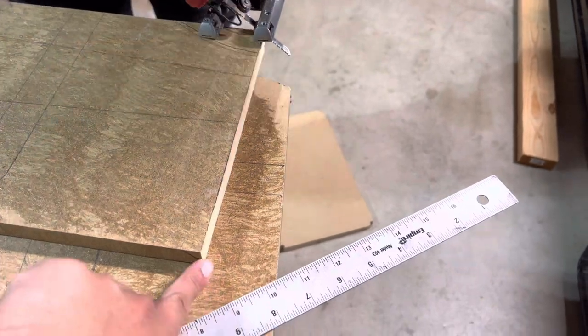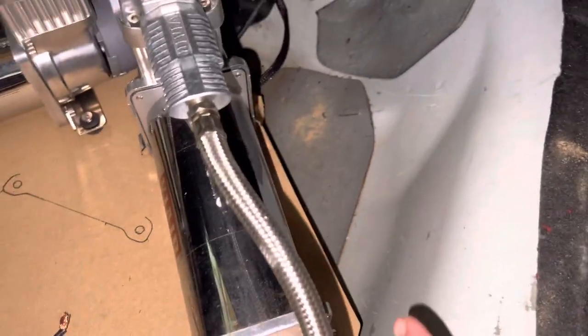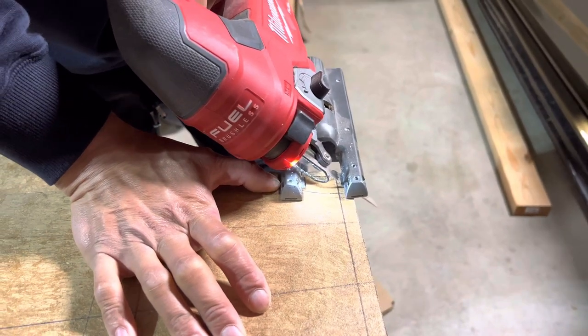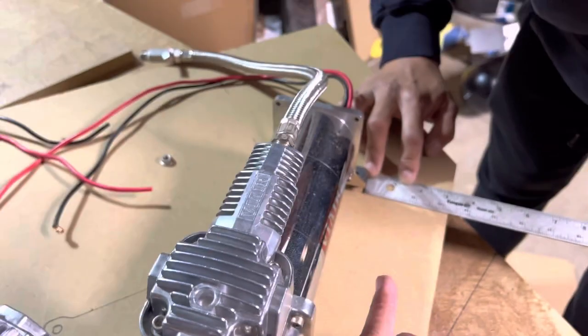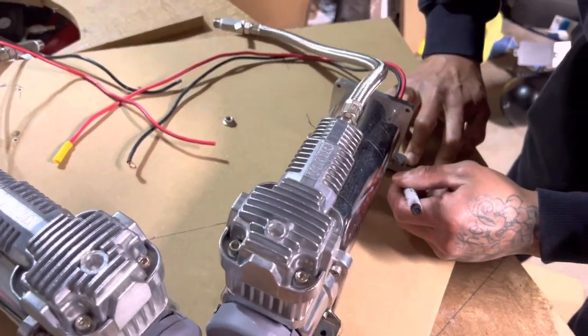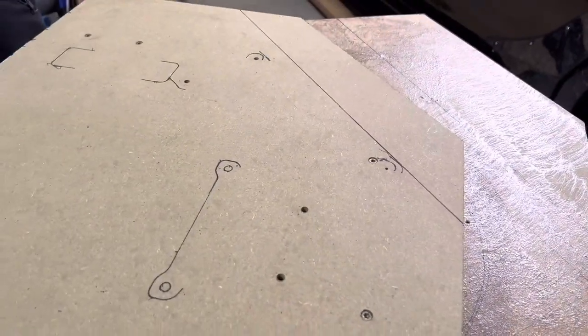Right now we're about to do a 45-degree angle cut from the back side because we need to clear this back area — it's hitting the point area going to the top. Test fit and it clears the side — let's go. We measured the distance from the edges and we're going to mount a board going up here. It'll be slightly shorter than this side so that way when you look through it from the top it looks even. We're actually going to chop off this top MDF so it's even, and leave the bottom woods under it to keep the same position inside the trunk.